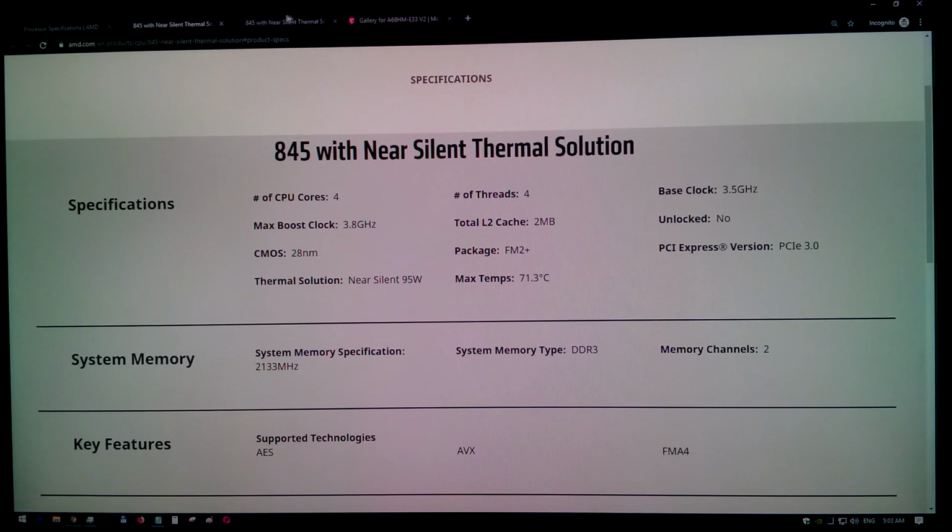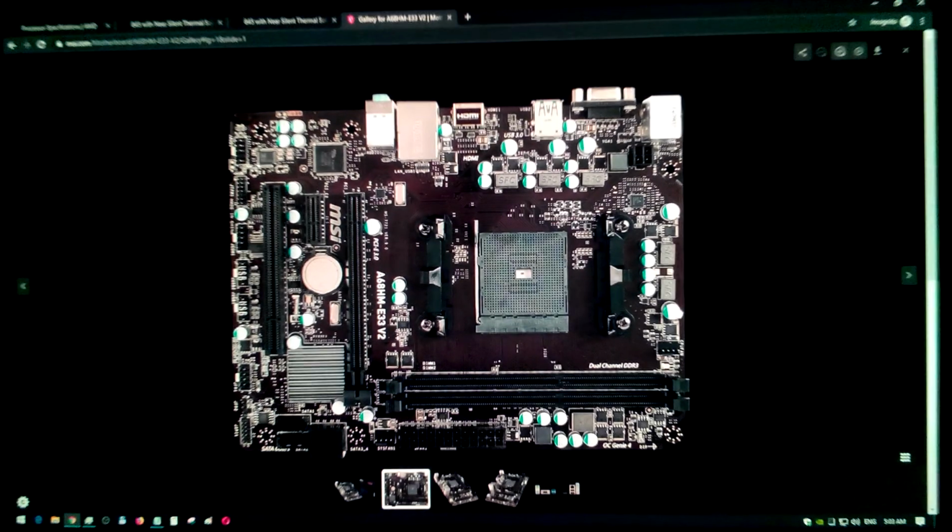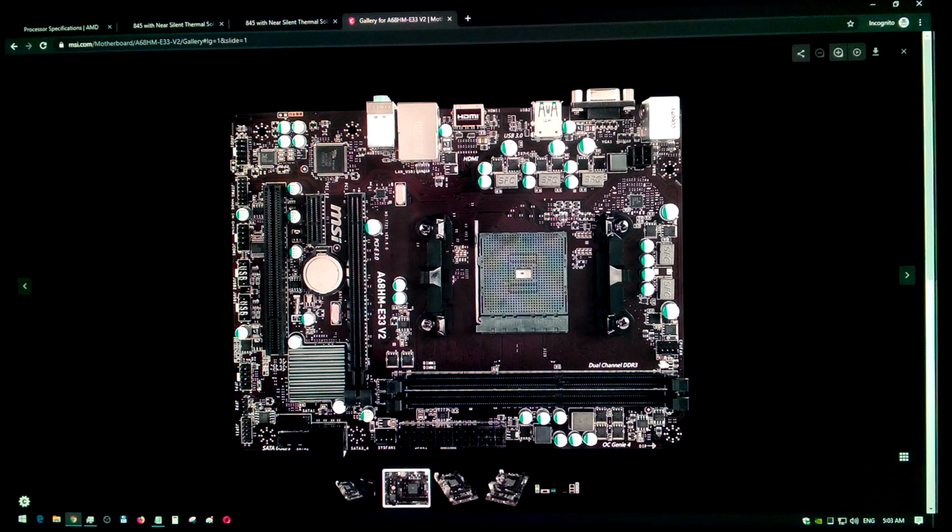So, the interesting thing about this mainboard is that the CPU fan can only do PWM. It gives pulses to the fan, which tells the fan how fast it should spin. Meanwhile, the system fan here can be set to voltage regulation. It will decrease the voltage if the fan needs to spin slower, and practically any fan can be plugged in there, without 3-pin or 4-pin, just the 2-pin fan.